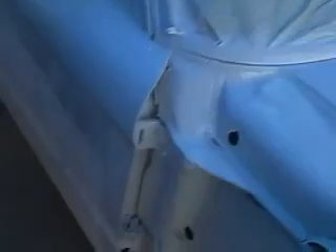I know what my paint's like now and where I've got to sand and what I'm going to aim at. That's why I did a couple of these test patches here and one also right here. This was a light coat over some Bondo that I machine sanded with 80 grit — that'll give me an idea how well it covers.